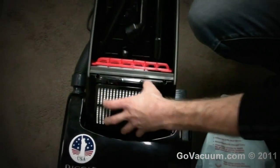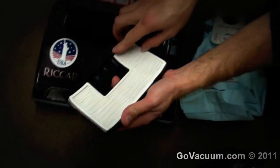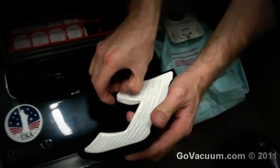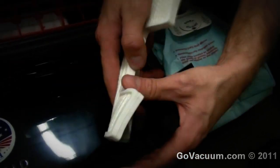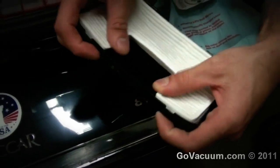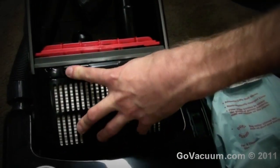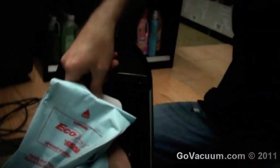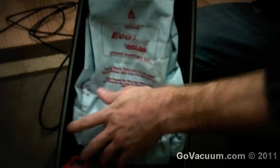You have an exhaust filter that goes here. This is a pleated style filter. We do not call this a HEPA filter — it's not a HEPA, but it's a pleated filter that's HEPA-like, with rubber around the side, and it is a good filter when it comes to filtration. You can also get this in a much thinner form, but it comes with this one so you might as well use it. The HEPA style bags — I do recommend those if you have allergies, as those bags really work better, and they're just made out of cloth.